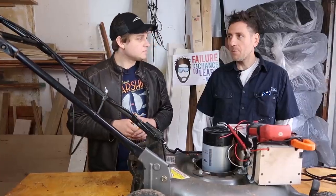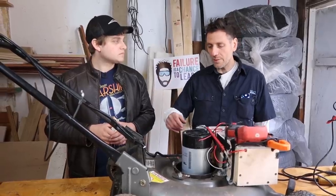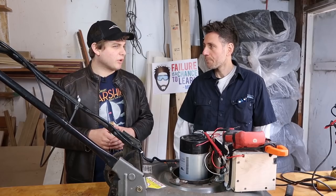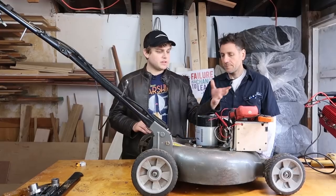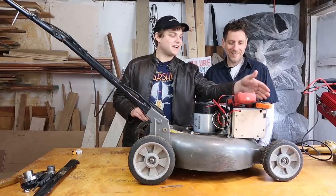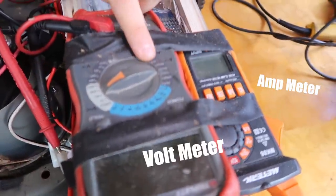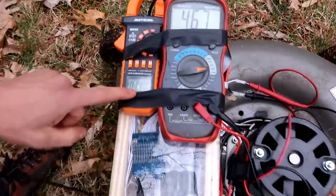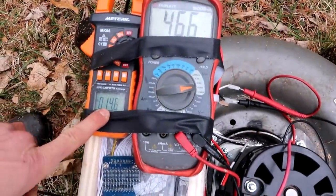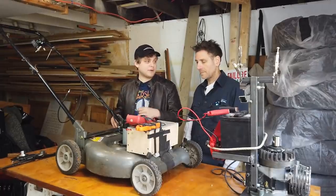You would need a double-pole switch so you could do two operations, or just have two switches tied together somehow — one would be a brake and one would be power. That's a little scarier, so go for the proper switch. We also strapped an amp meter and volt meter to the mower using tape. This allowed us to monitor the volts of the whole system and the amps going to the motor, which told us the watts the motor was drawing and the voltage of the battery pack.